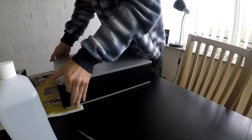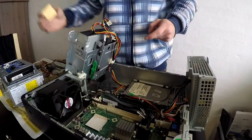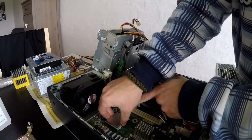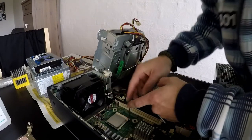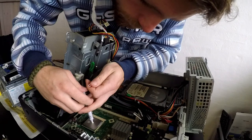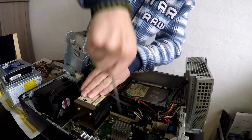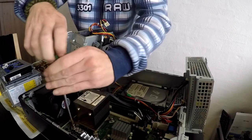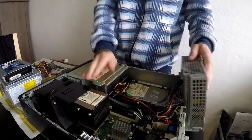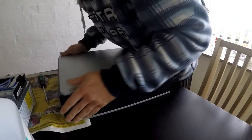So I took my nice little setup apart, opened the top panel yet again, and started to remove the heatsink. I cleaned and removed the CPU from the HP PC and did the same with the one from the damaged motherboard. After this it was pretty easy to seat the new CPU in the old socket. Installing the new RAM was no issue either — they pretty much just slipped right into place. I then put a nice pea-sized dab of thermal paste on the CPU and reinstalled the heatsink, except the system still smells like an old smoker's lungs.